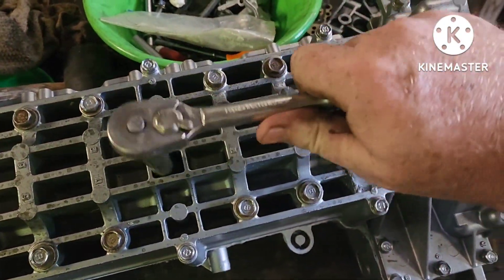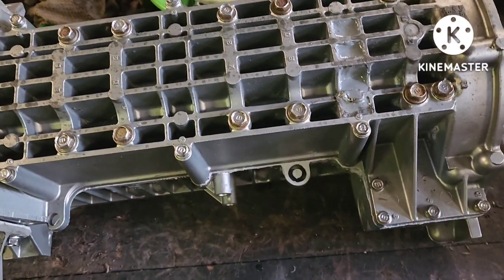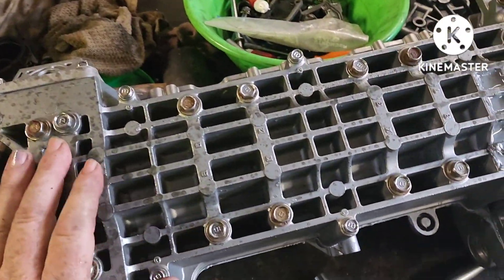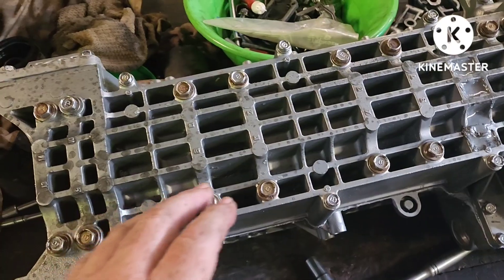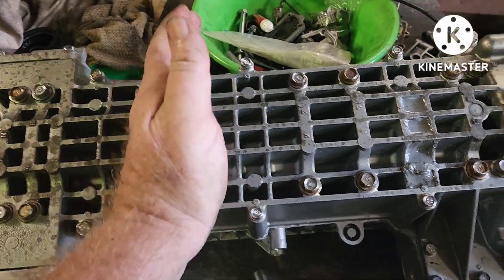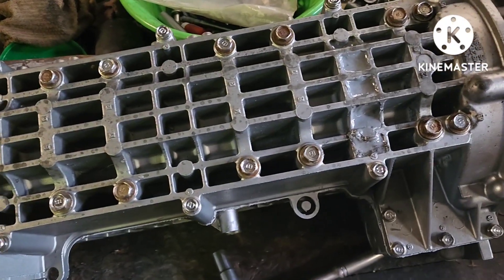How I do that — I choke up on the wrench like this. I'm not way down where I can get a lot of leverage, I'm way up here. I never spin bolts back on with an impact — I don't do that. It's too easy to strip stuff out, especially when you're working with aluminum. I use hand tools. I will take them apart with an impact, but I never put them back together with one, because I don't want to create more problems for myself. Now we'll go with our torque sequences. I'm going to do the large bolts first. If they weren't numbered, you would always go from your center, working your way out as you torqued your bolts down to spec. And then I'll go with the 10 millimeters, setting them to their inch-pounds of torque.